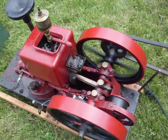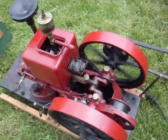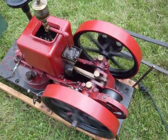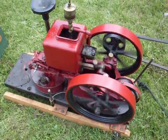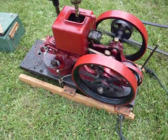It's got the brass connecting rod and the churn pulley. It's got quite a bit of blow-by — it's about time for a new set of rings.